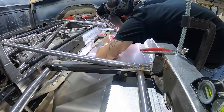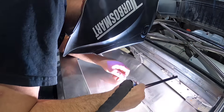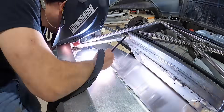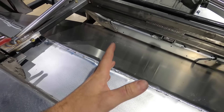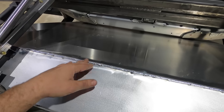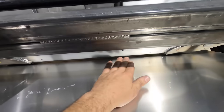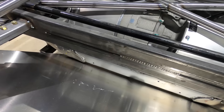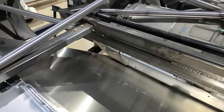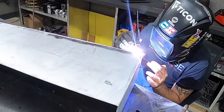The rear diffuser is all welded up. We put a lot of heat in this thing, so hopefully it pulled up to where we want it. I'm going to leave these welds proud, clean them up, and underneath I'm going to blend these little stitch welds in. We also marked where this thing's going to bend up - I'll probably end up cutting this out, taking another piece underneath the subframe, and just welding that edge. Then we'll pull it out, cut that piece, and start making our side splitters for the diffuser to start directing the air out and getting this thing looking more and more like a complete diffuser.